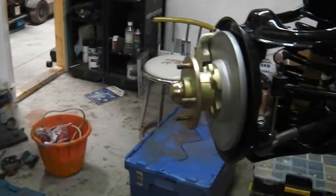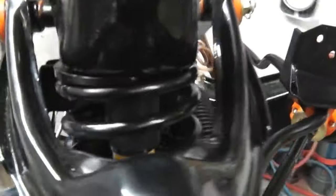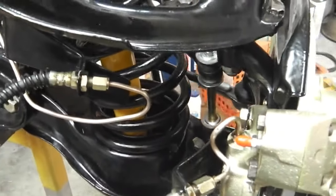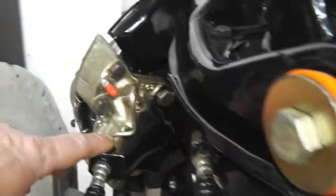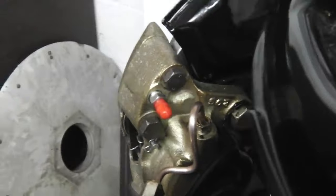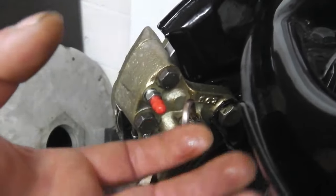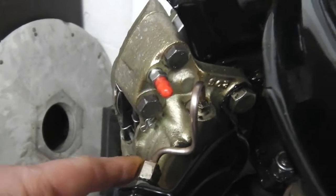We also managed to get ourselves a nice brake bending tool from the NEC, a tip off from Mark there with Fury, the Mk3 Cortina D restored. So we managed to get a great shape on our caliper brake tubes here, just with that tight fitting on your caliper there. You can use a nice little brake bending tool, which we'll show you. It's a compact little mini set of claws that you just use to get a good right angle without crushing the tube, so that worked well.